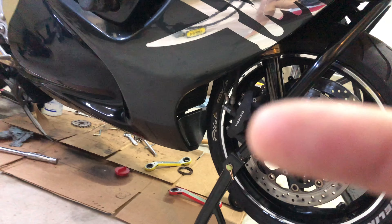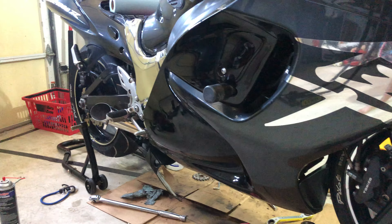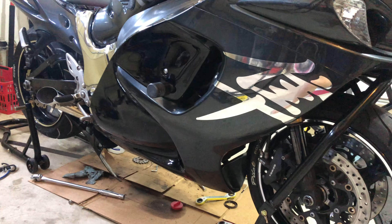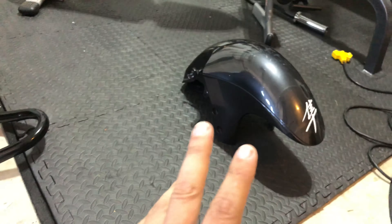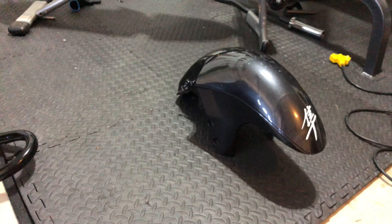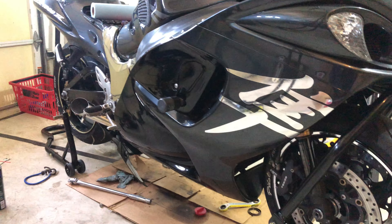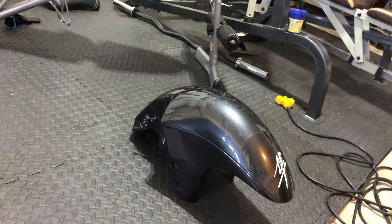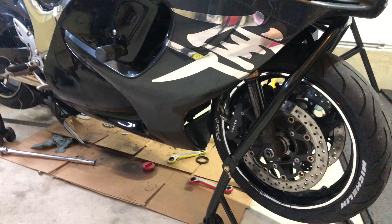You're no longer taking fairings from the bottom and pulling the pin and letting it come down. However, any type of thing where that bike has to be elevated in the air, you're taking that fender off. But that's not a deal breaker for me because all it has is three bolts on one side, three bolts on the other side, and that quick it's off. I can take it off that fast using a power tool, but if you have to do it by hand with just a ratchet, you're going to be there for a hot minute.